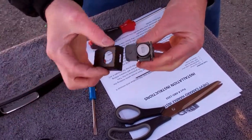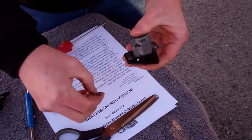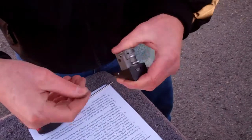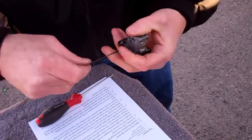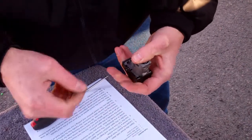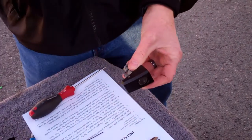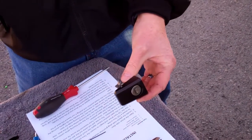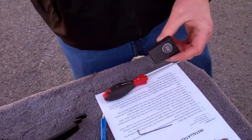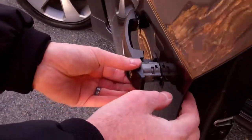Take your new cover, line it up on the piece, snap it into position, and now tighten the Allen screw provided with your 3/64 Allen wrench until it holds the part secure. Make sure as you're doing the other doors that the screw will be on the bottom once installed on the car — there is definitely a passenger and a driver's side for that piece. You'll also notice that the other pieces on the car do not have a lock hole, but they go on in just the same fashion. Once installed on the lock piece, slide it back into the door.